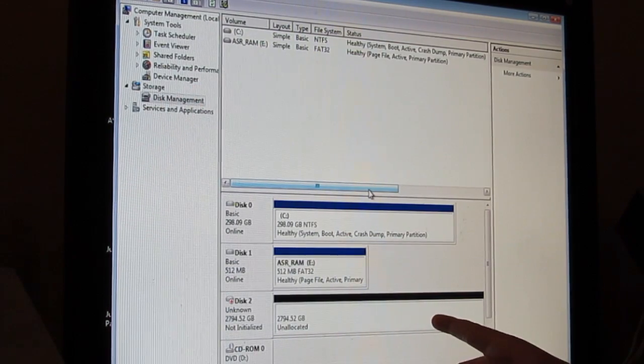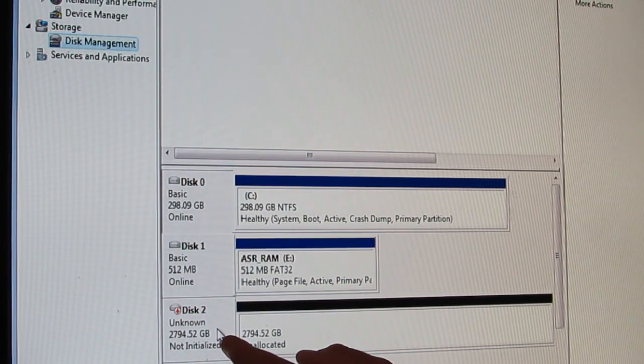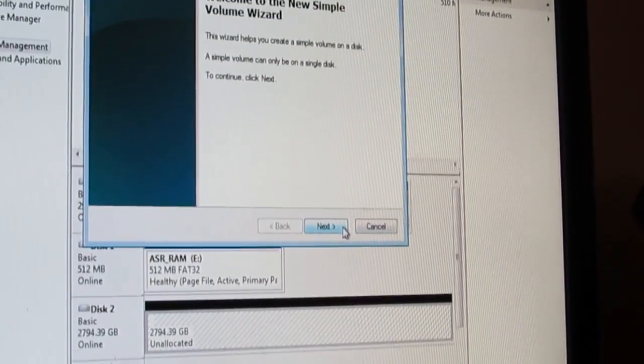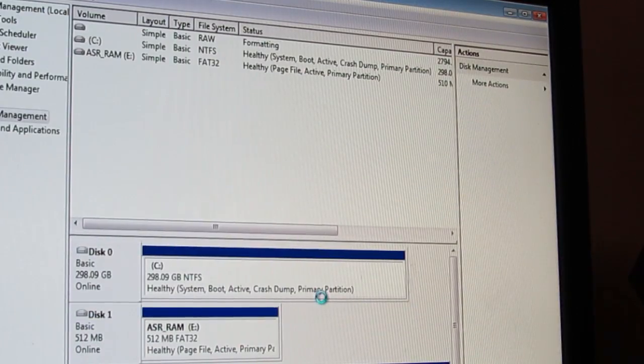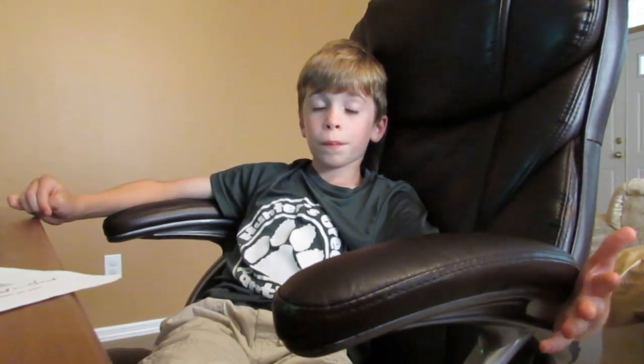You can see the new hard drive here and it has almost 3,000 gigabytes. Right click on Disk 2 and click Initialize Disk. You're going to want to press GPT. If you initialize your drive as MBR then less than 2 terabytes will show up. If you initialize as GPT then you can use a larger drive that can have 3 terabytes or more. Then right click on the box and press New Simple Volume. Find NTFS — it should be set to NTFS. We did NTFS because then you can format all 3 terabytes or more; if you use FAT32 the whole 3 terabytes won't show up.